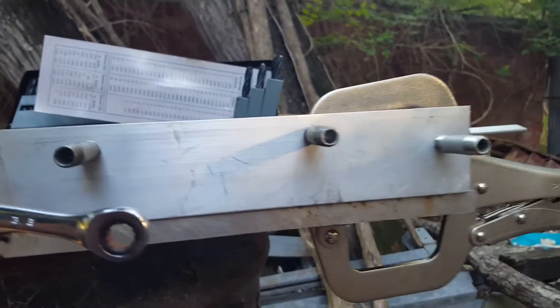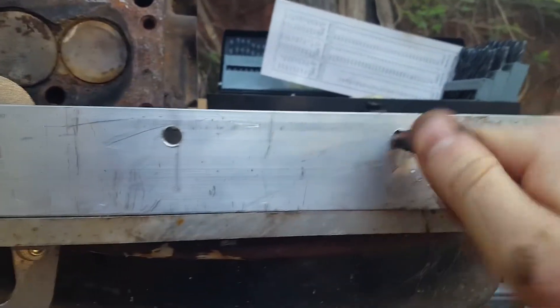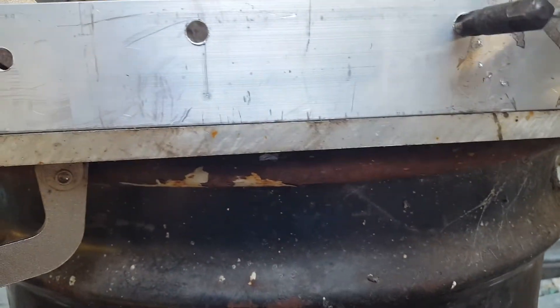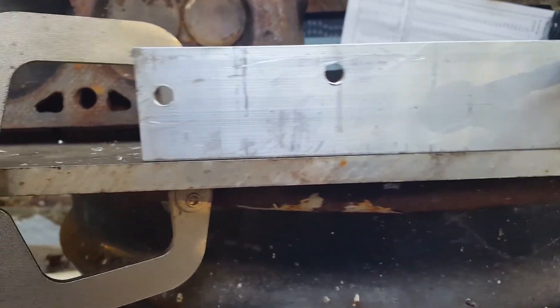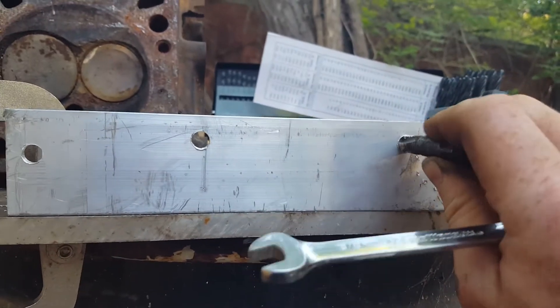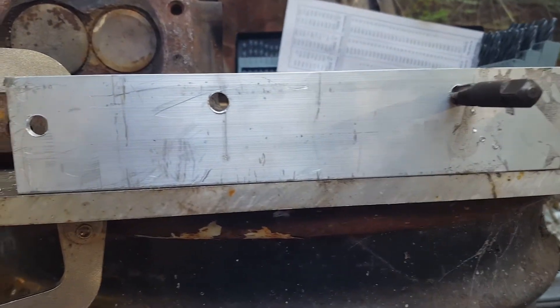Okay, here's some of the action going into place. I've already drilled the holes — you can see these are already going through there. The thing with aluminum versus steel is that even with a T6 heat treat, it likes to gum up. That's why when you cut it with like a jigsaw or something like that, you want a real coarse cut and you don't want to get it real hot because it will gum up the threads — and it's fun to pick out. I'll show you all here in another second.